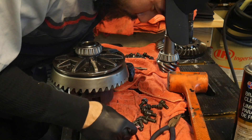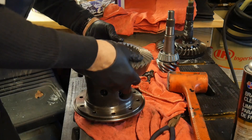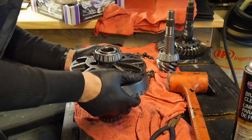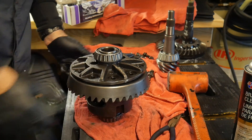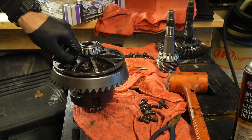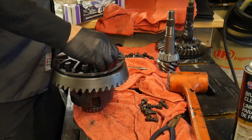A little bit of red Loctite — it actually came with the bearing kit. Some people like to heat up those ring gears and put the carriers in the freezer to get things to line up a little bit easier. For some of the bigger Dodge trucks you might want to do that, but this one's small enough where you can just pull it on. A lot of people talk about the ring gear possibly warping — some people file down the back side and make sure it's straight, but I didn't do it and I'm not too worried about it.